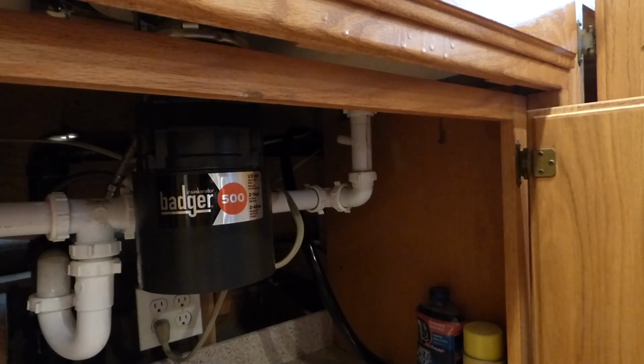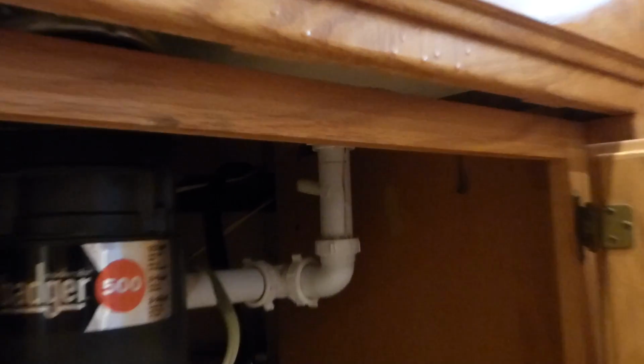Anyways, the other thing I need to do here is hook up to the drain. This particular model, as you can see, back in there, I'll zoom in, has a drain like this under the sink. Alright. There's a 5/8 tube coming off of here. And the pipe's going to go right on that and once again clamp down with the radiator hose. Now, the pipe I have here is a little bit long still, it's 10 feet. I might take a whole foot off of it, but first I want to make sure that it goes back